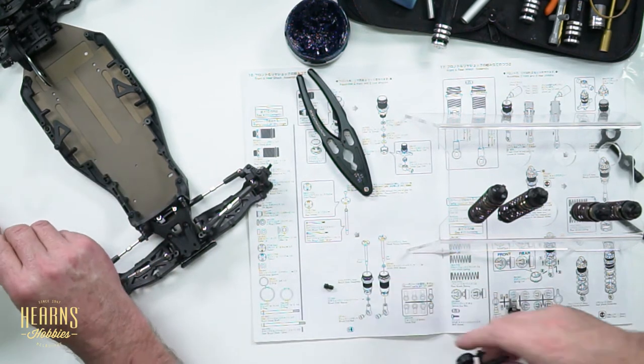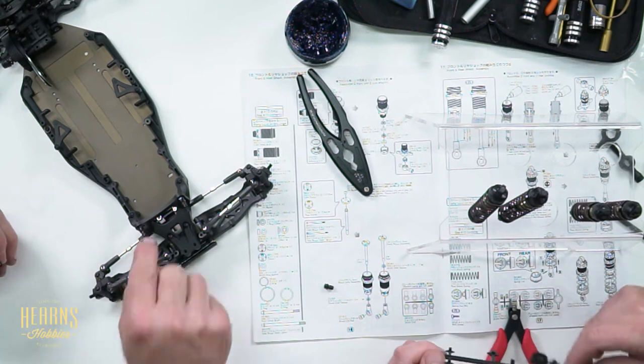There is an optional aluminium one. And on my car, I run optional aluminiums on the front. Do you know why? Because you nose-dive it into the jumps all the time. When you crash, which you will do, you can bend the screw. But when you put the optional threaded aluminium ones on, it helps to reinforce the screw and stops them bending and breaking. The reason I don't like the alloy ones is because I actually like to adjust the pre-tension on the bush. Why? Please explain. Because you get a bit of feel. I know you like yours all loose and rattly. Feel? What feel? You can feel it, like that it's tight, the shock on there, but it's smooth. But then when it gets crap in there, it binds up. It doesn't get crap in there, mate. Only if you nose dive it upside down into the triple.